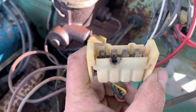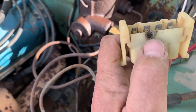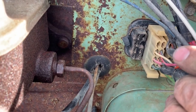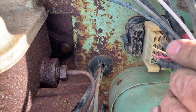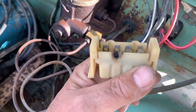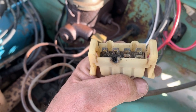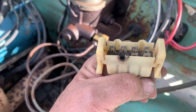Eventually that would have created a problem. That's pretty typical of a truck that's been outside most of its life. This is the main power lead through the harness, and you can see it has burnt the bejesus out of the harness — which is why it's stupid to run all your juice through a connection that eventually looks like this. You can run thick wire, but if your connections look like this, you're going to create heat with resistance.